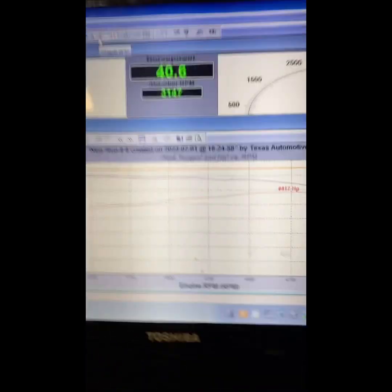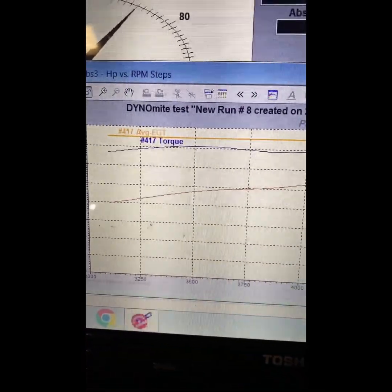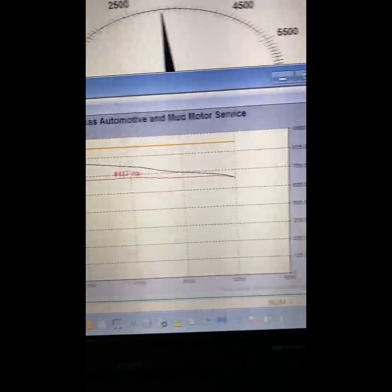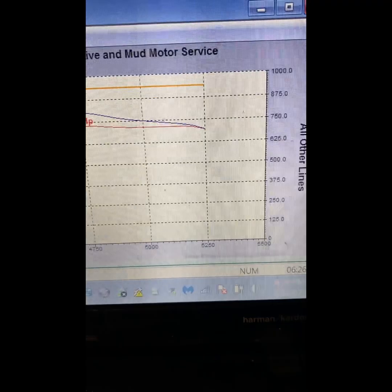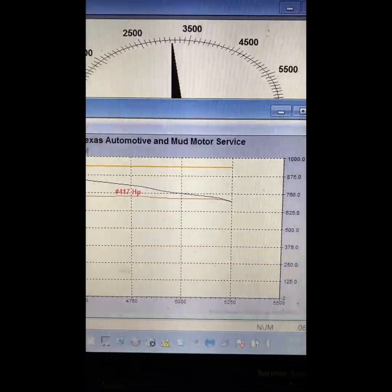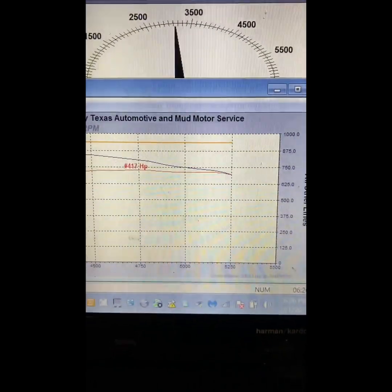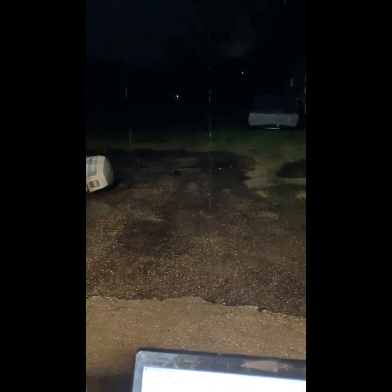It seems a little cleaner that time. We've got about 71 pounds of torque and 58 horsepower. It didn't increase a lot of power, but she pulled clean this time - she didn't give up so early. I'm pretty comfortable with that number considering it's raining outside. That's a lot of humidity - cold, nasty air. I like cold air, but humidity makes it even worse.